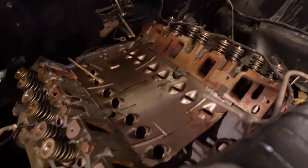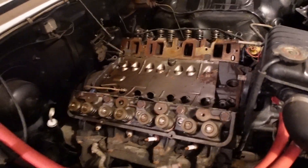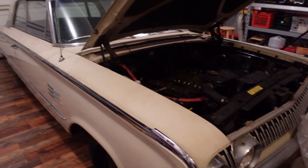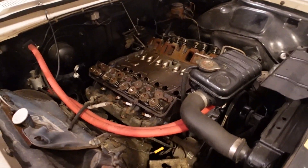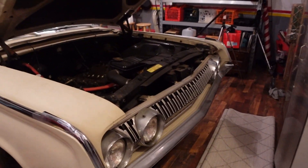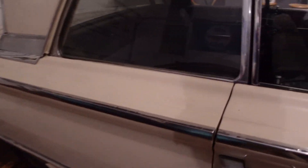The car doesn't have an intake manifold on it, but the motor looks very fresh inside. There is some surface rust, but it's still in pretty good shape. I think we can clean this up, put a new intake on it, put a distributor on it, get everything hooked back up, and it should run and drive. The transmission worked pretty good in it — the only issue was it was smoking. Apparently the guy refreshed the motor and the transmission, and then it was sitting when he pulled the intake off. It's in really, really good shape, it just has been sitting.